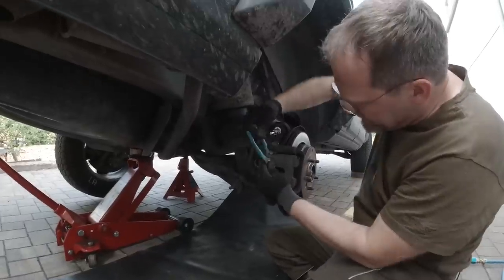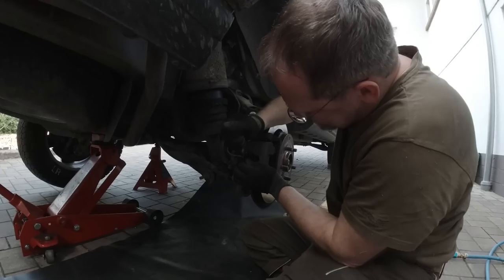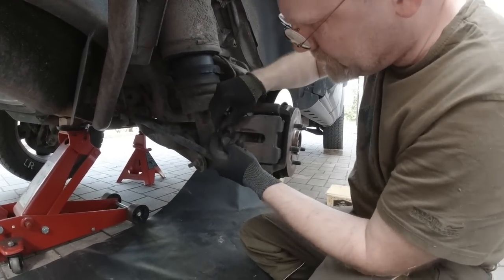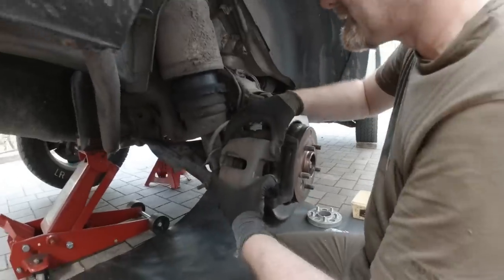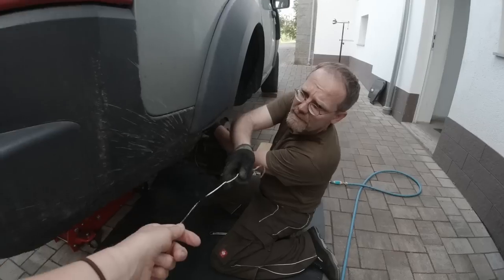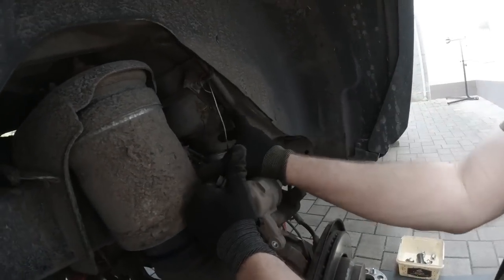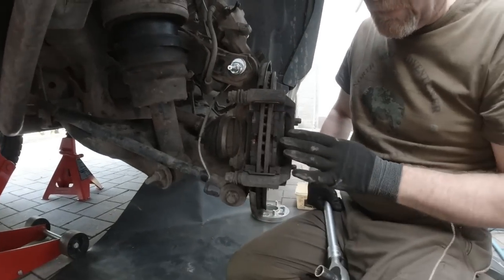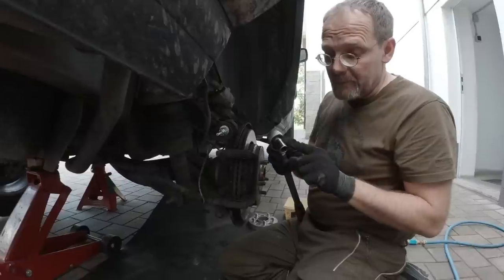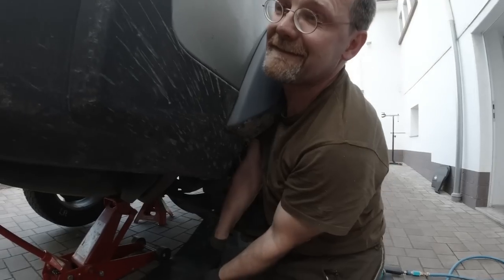Here you pull this wear sensor out right away in the beginning. It just pulls straight back. See? And I always use some silicone glue to glue it in. Get me a wire tie. You know, clothes hangers. Okay, just before it falls on us, we'll hang this up here. The fastening bolts for the mounting bracket here require a 12-point socket. You gotta pay attention to have a 15mm 12-point socket in your toolkit.